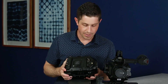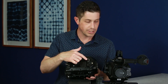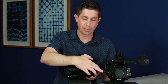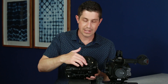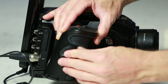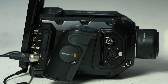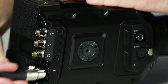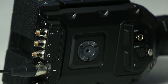On the side of the camera, there's an SDI out and there's a 12V out. The SDI out is typically going to be used for the viewfinder like we have here on the broadcast, and the 12V also would provide the power for that viewfinder. Below that, there's a LAN-C controller for lenses that have that option, and then a separate lens controller. The rosette that's built in here is designed for the control handle that comes with all of the cameras. On the back side, we have SDI out, which is a 12G SDI, SDI in, reference or timecode in, and then a 12V 4-pin adapter here as well.